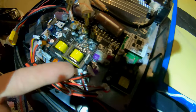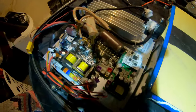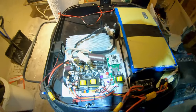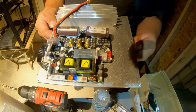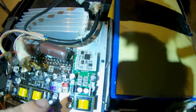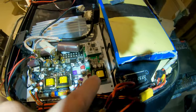First step was unplugging all the little connections and unscrewing the control board, which is apparently held on with wood screws — an interesting design choice. Hopefully those wood screws grab back into the plastic when we replace the board. Also, the new board they sent doesn't include a sideboard, which I assume is the Bluetooth or communication board. So if you're salvaging a board and swapping pieces, make sure you save that little sideboard.